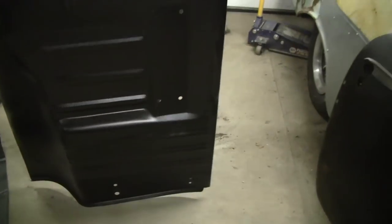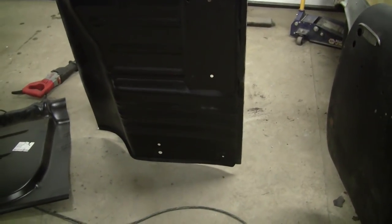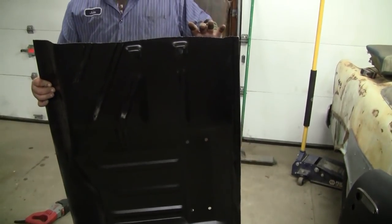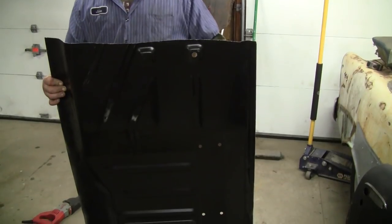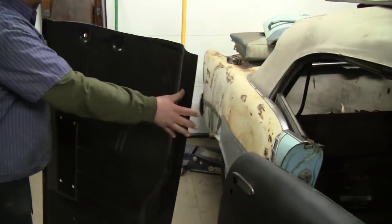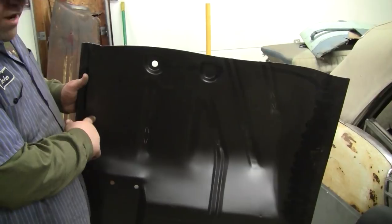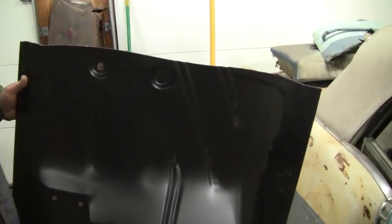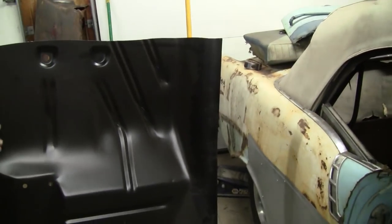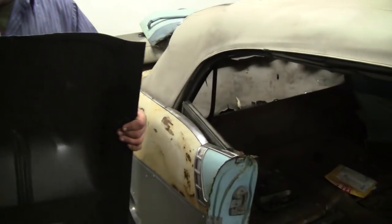As you can see, it's obviously not a straight line — it's contoured, more bent in and up towards the back. As we were measuring earlier, we had a shorter gap over here: roughly five and a quarter, five and a half down to four inches, so we want to taper it to make it fit nice and flush to the car. We have our support body mount which we want to stay a good inch and a half away from, which I have achieved. Now we're going to temporarily set this in the car, then we'll put the seat belts in and go for a ride — but that'll be in a couple more episodes.